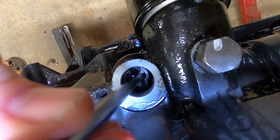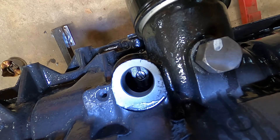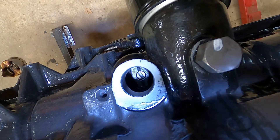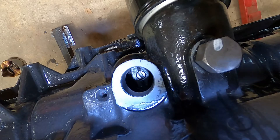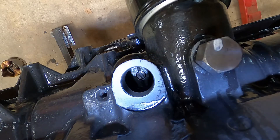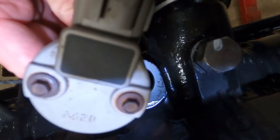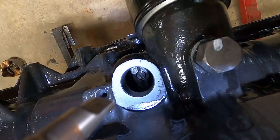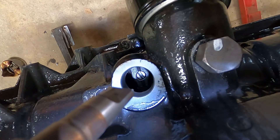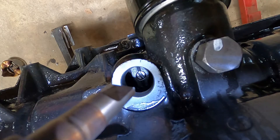I'm going to use a screwdriver, slide it into the oil pump assembly, and rotate it to about the eleven o'clock position. You'll have to play around with this a little bit to find the exact point needed for the cam position sensor to slide in. My check will be to lift the sensor up and confirm those two pieces are aligned — I may give it a slight rotation to the left before I start.